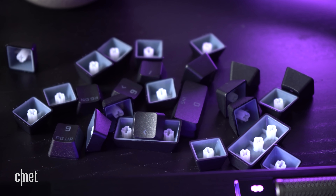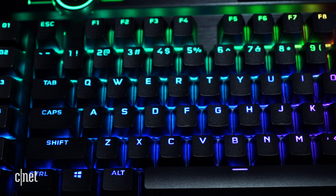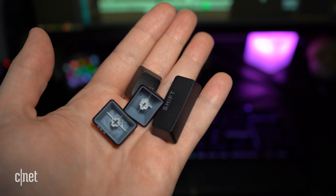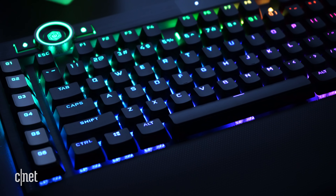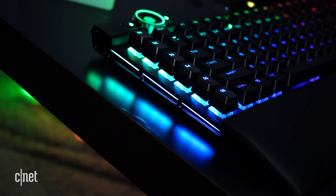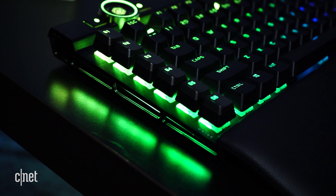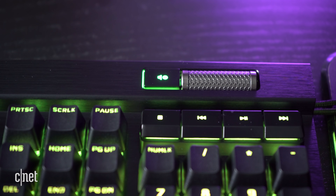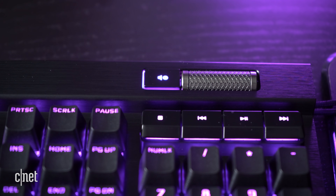Since those DoubleShot keycaps come standard, the texture on the individual keys is resistant to shine over time and will outlast their ABS counterparts. The legends on the keys will never fade or wear off since they are two individual layers of PBT plastic molded together. The six macro keys continue to come standard, and you won't experience any flexing in the frame with its solid build quality. The keyboard is quite hefty, weighing in at nearly 3 pounds. The keys sit over a brushed aluminum backplate, which makes cleaning easier, makes the colors pop more, and makes it easier to remove keycaps. The media keys have their own RGB elements in sync with the rest of the keys, and the textured volume bar has a very premium look and feel with a smooth glide.